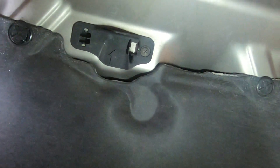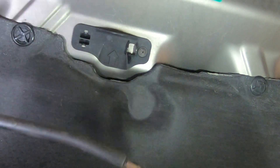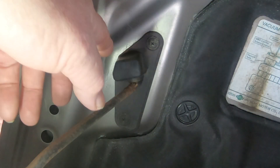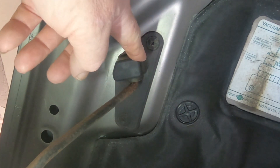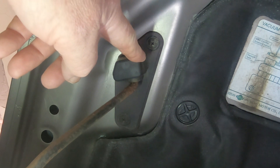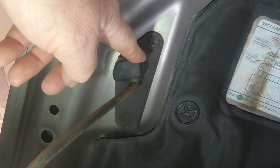And now if you don't fix it, when they slam the hood down, this will put a lot of stress on the other plastic piece that holds the rod where it's supposed to be. What will happen is this part here will break over time and you'll have to replace this as well. Generally people don't bother to replace these — you'll see that most people who own these cars carry a little wooden stick around with them to hold the hood up.